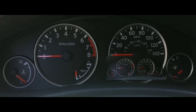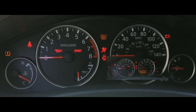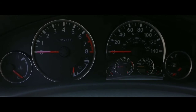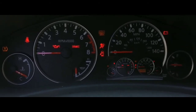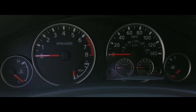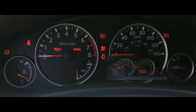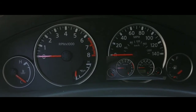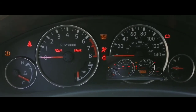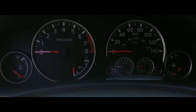Moreover, I think it's probably the starter unfortunately. I've only put maybe 10,000 miles on this starter in the last eight months. I could go out and try to bump the starter and start it up, or run a cable to the solenoid positive line and see if the starter works — but I'm not going to do either of those things because it's raining outside right now and that complicates the situation.